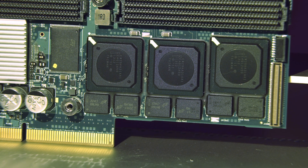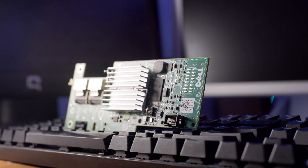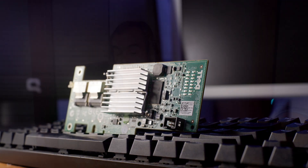The Intel 910 gets a lot more complicated because it's essentially four drives in one — it shows up as four drives in your operating system and you have to run RAID on it or deal with it as four different drives. I normally ran RAID 0 for all of my tests because it made a good amount of sense and gave me the best performance. If you have a system capable of SAS drives, those SAS drives are plug-and-play and super easy to use. But if your system doesn't already have SAS support, you need a SAS HBA, which is another component that goes in a PCIe slot.